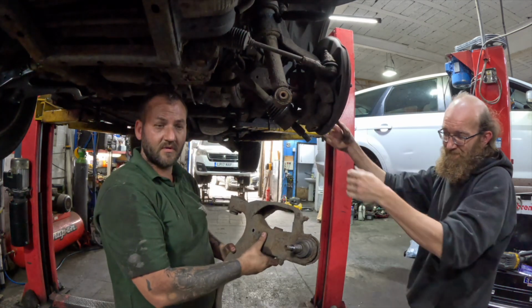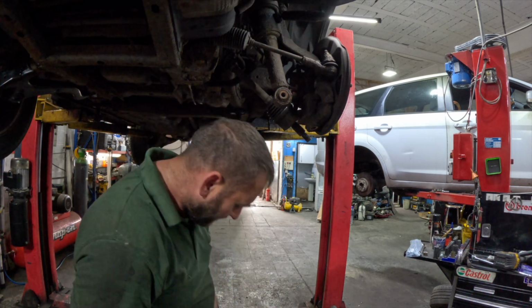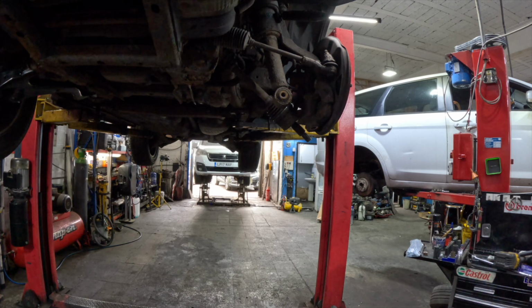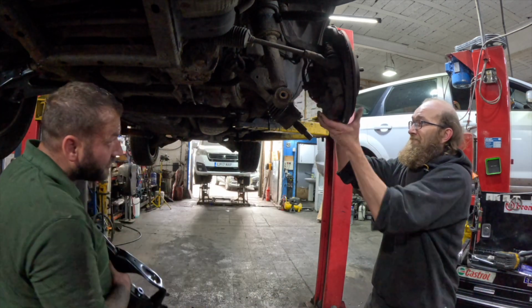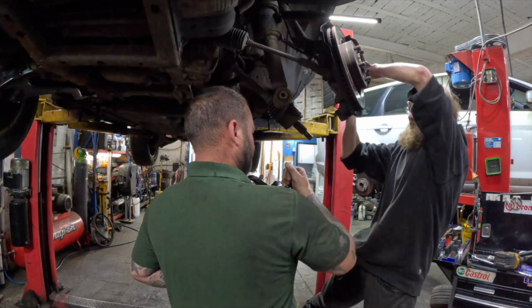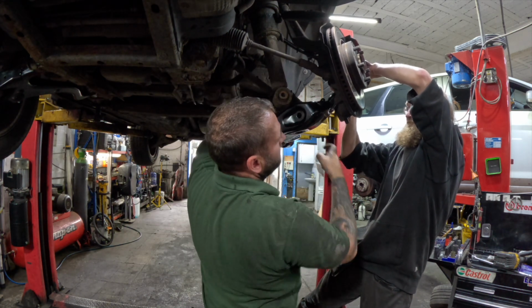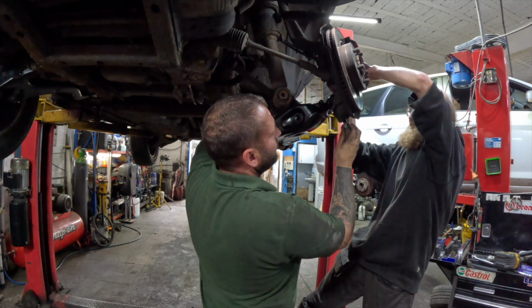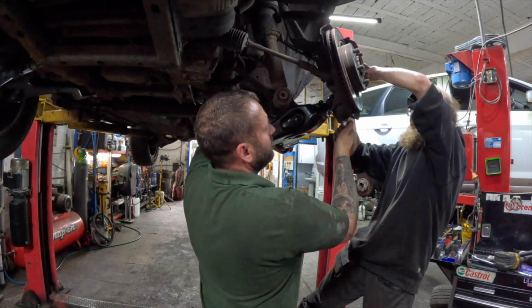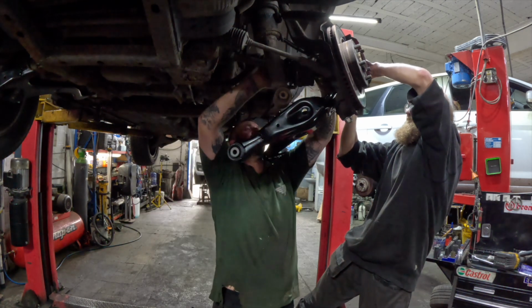That's one wishbone out. So we've got our brand new one there. I'll tell you where we get them from in a minute. And if Bob pulls that out again, we can get the new one in. Get the nut on nice and loose. And Bob's got the hub out, we'll get the drive shaft back in.